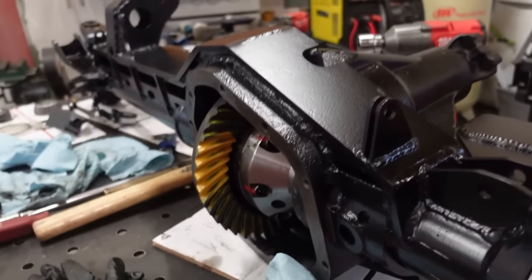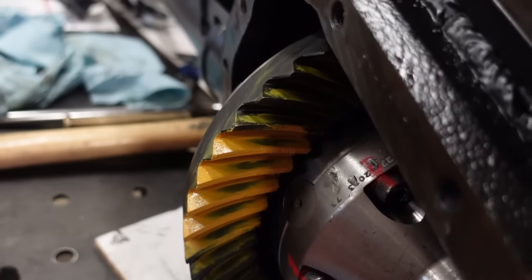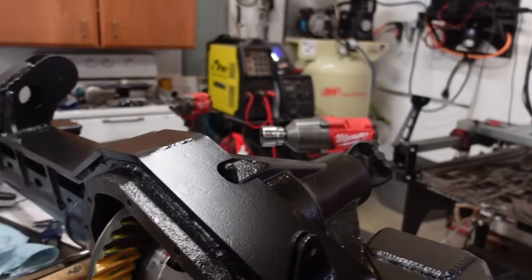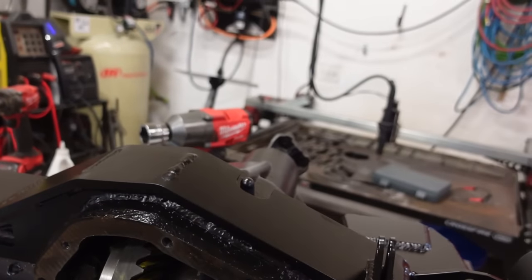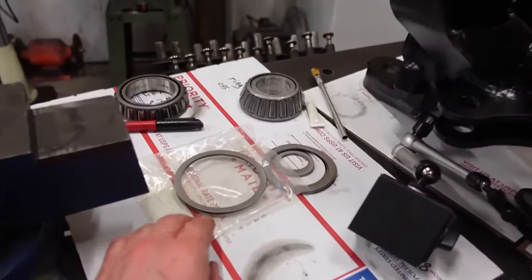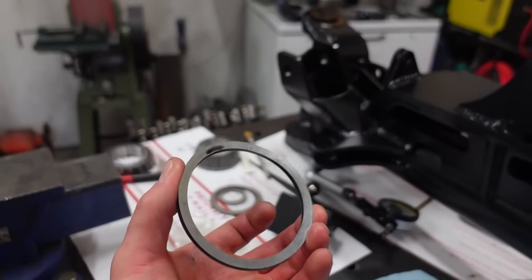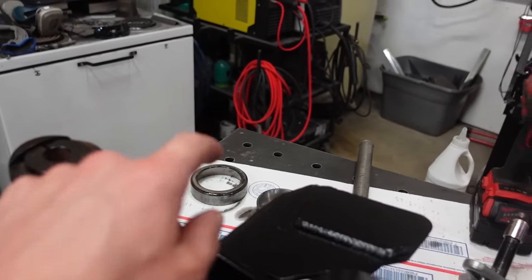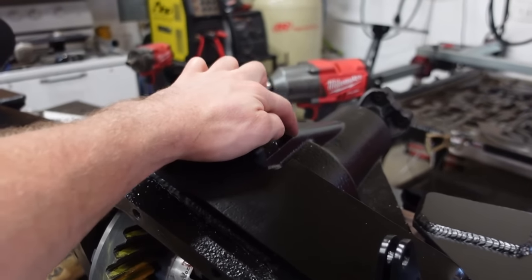Well, guys, I'm at a complete freaking loss. I'm pissed off. This pinion is way too close, you can see, looking at the pattern now that everything in the axle is perfectly set up. We've got to destroy it all. The problem is I can't remove my pinion, because what these shims right here, which I didn't realize, actually, to change the pinion depth, you're supposed to use these shims, which go behind the bearing cup for the pinion, the main one here, to get that bearing race out to shim it.